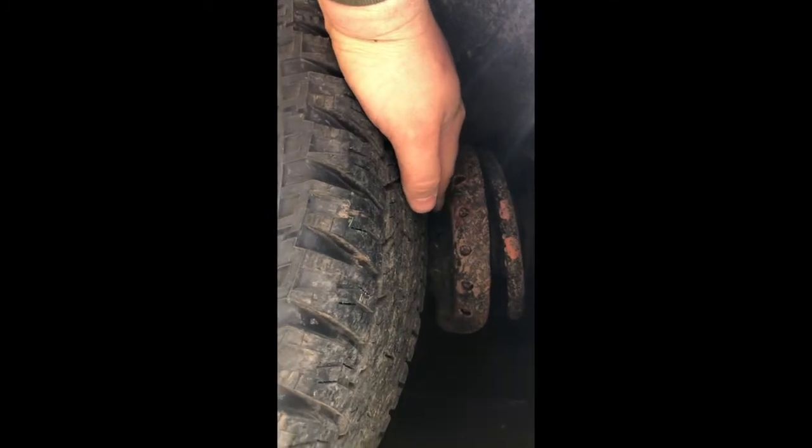I haven't seen any rubbing, but that might give you Subaru guys a little bit of information that you can run larger tires on your stock wheels if you do this Forester lift. I can't say that it will work with the spacer lift. I think it won't, because the way that this top hat is adjusted with the Forester struts, it's not adjusted with the Impreza struts or Outback struts. So just food for thought, if you give yourself that factory lift, you can run a taller tire on a stock wheel and not have any rubbing. So just wanted to share my experience with that.